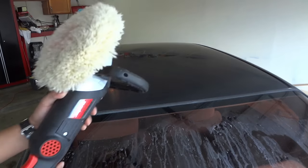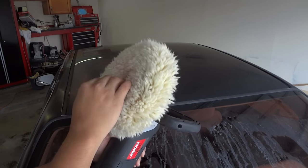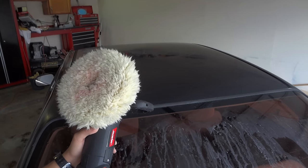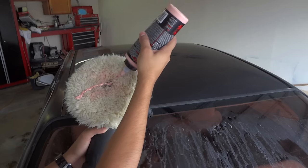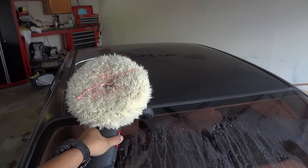This is what the sanding looks like. It's removed a lot of oxidation, and now the buffer is going to remove all the scratch marks from the sandpaper. With the polisher, once you've placed everything together — your disc, your pad — all you need to do now is apply the compound. You don't need too much compound but don't put too little either. This is about how much we're going to use — just one ribbon of compound, that's all we need.